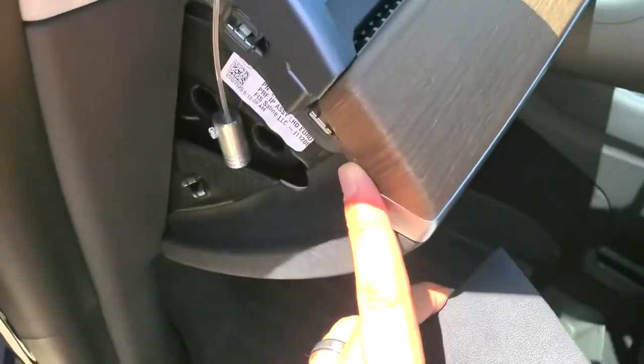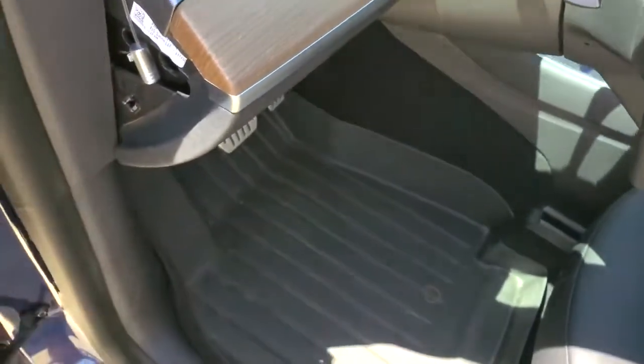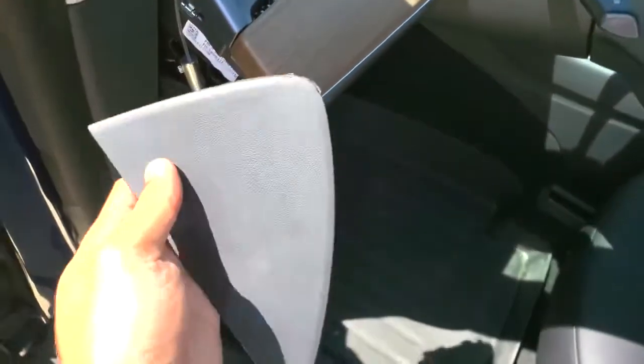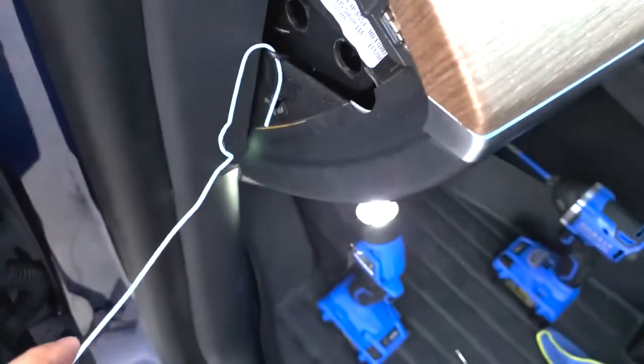If it doesn't come off here, and you can see I kind of scuffed this wood here, but hopefully it'll be easier for you guys. This was actually a little farther in than most pieces would be for the trim, but hopefully it'll be easier for you to take that out. When you can't pull out a wire, you've got to fish it.